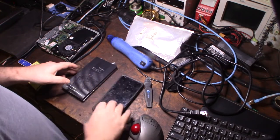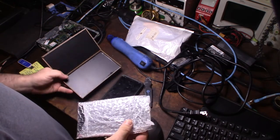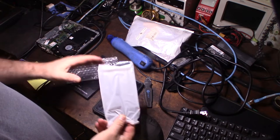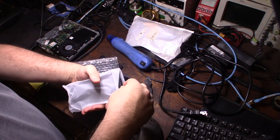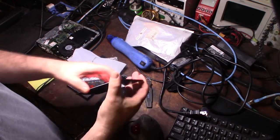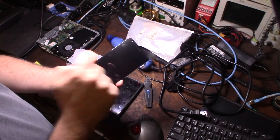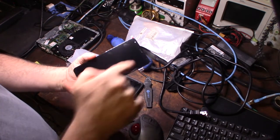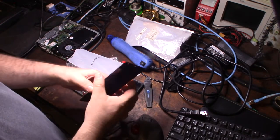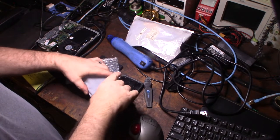Alright, so I ordered this on Amazon. $35. But this is actually just a screen. Typically, you shouldn't waste your time if you don't actually have the digitizer. It's nearly impossible if you just buy the actual glass without the digitizer. The digitizer is basically the touch. When you actually touch the screen, that's what moves your stuff around. That's a digitizer. So don't even bother trying to just replace the glass without the digitizer because it's impossible. I've broken many, many screens trying to do that.